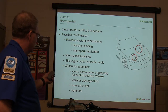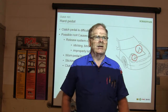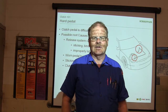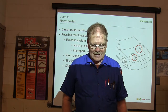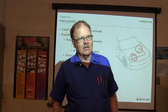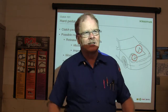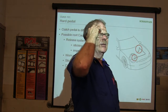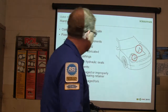I've also seen some people put these hot rod clutches in there — super-duper clutches for people doing crazy racing. That clutch has got so much spring pressure that you've got to have a serious leg to mash the clutch even in normal use, because they're trying to get it to bite really hard. There used to be a brand of clutch and every time we saw one of those put in, people always complained because it was too hard to mash the clutch.